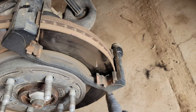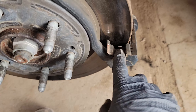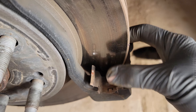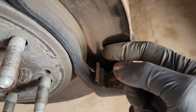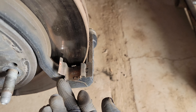Pull those bolts out, pull the caliper off, and we're going to replace these clips and grease them up — right in here where your pad slides back and forth. Sometimes people put brakes in without this hardware and when you let off the brake pedal the pad isn't sliding freely, so it sits crooked and you'll hear a constant squeak. I've seen cars where people replaced brakes and didn't even put the hardware in — the pad is basically floating around in there and hitting at the wrong spots, causing all sorts of noises.